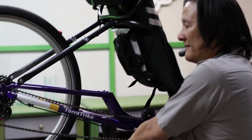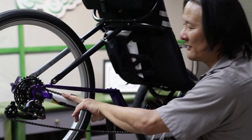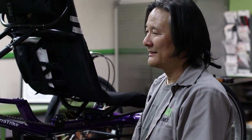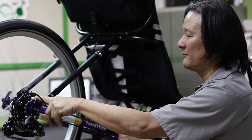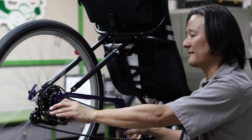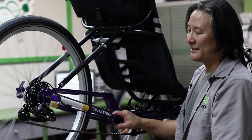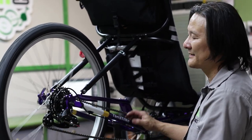You can use a stool, bag, or box to lift up the back while you're doing this. Keep in mind this is a quick home adjustment and a warning signal — it's letting you know it's about time to bring the trike in for a tune-up. If it recently had a tune-up and is going out of adjustment, either it's just breaking in — especially if cables and housings were changed — or there may be damage to the rear derailleur. This can happen if you transport it a lot or accidentally hit something. If it doesn't adjust quickly, we should take a look.